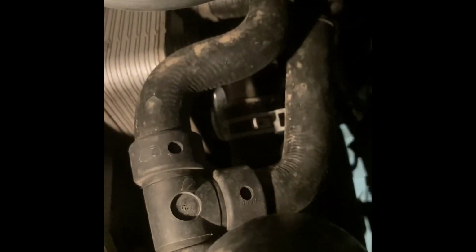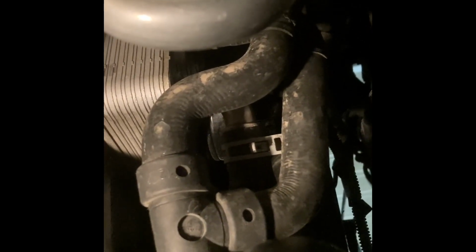Like I said, it's a little pain, but what I do is I stick my hand behind these hoses, wiggle it back in there. You want to make sure that the oil pan is fairly empty before you take the filter off, because otherwise all those hoses will get dripped oil on as you're taking it out if there is a bunch of oil in the filter.